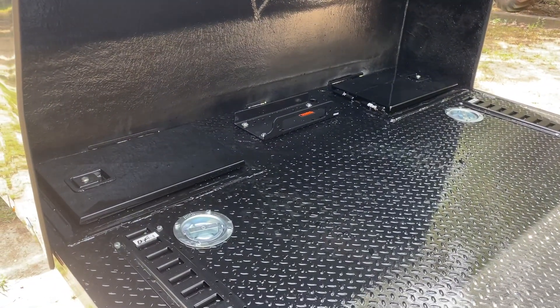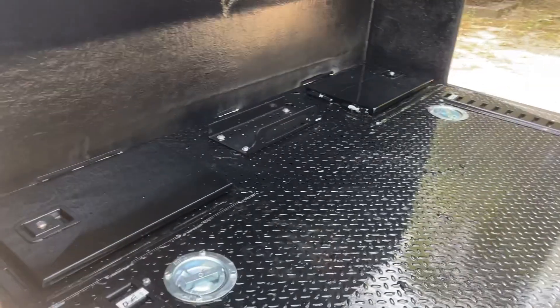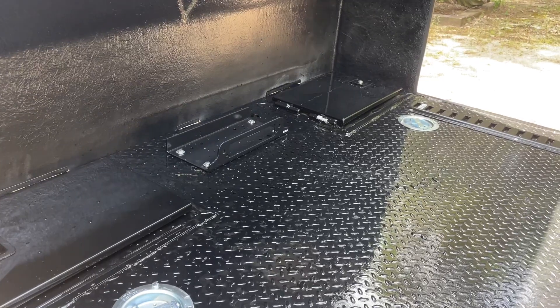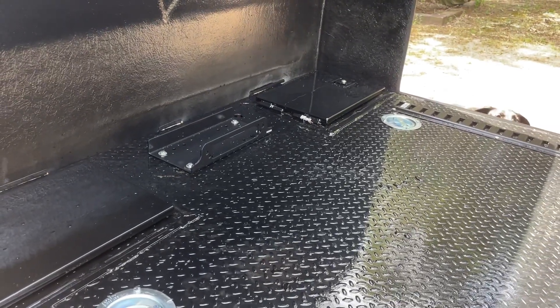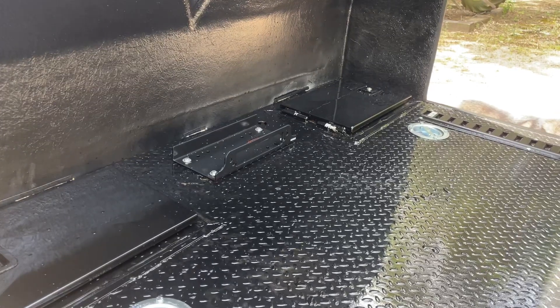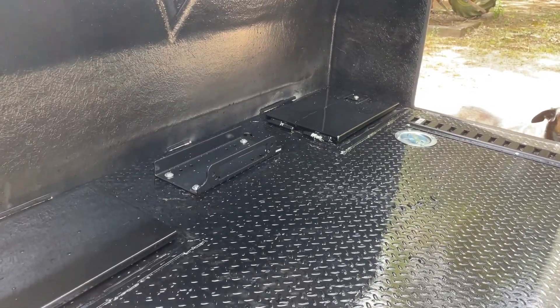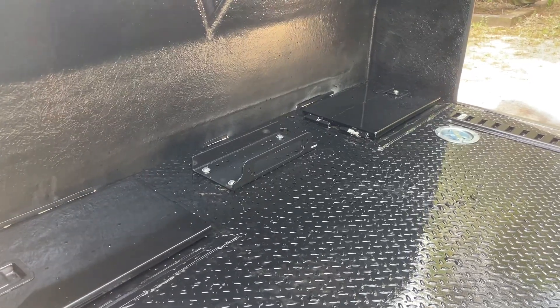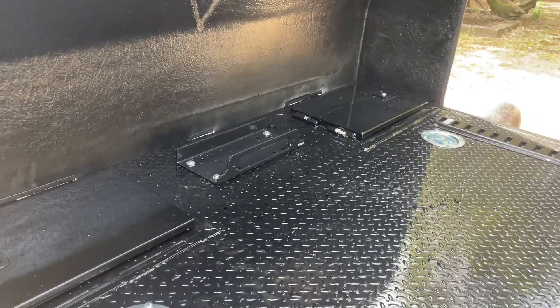Being the Deluxe Series, it does have the TFT exclusive deep toolboxes. It's got the winch plate and it is winch ready, which means it's already got the charger up underneath the trailer wired into the system. It's got the battery tray in the passenger side toolbox, and your ground and hot wire are already run over there — so all you've got to do is drop a winch on it and drop your battery in that box, and I'll show you that in just a minute.